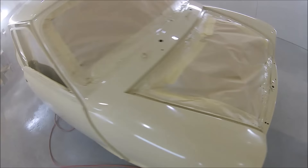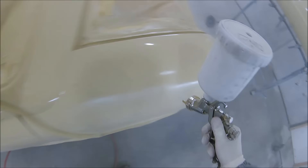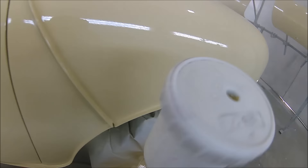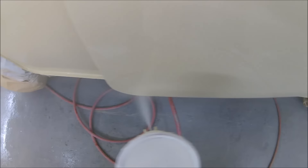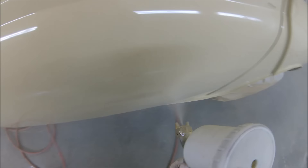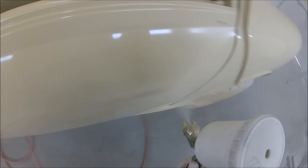Coming in on the last section, I hope this video gives you a good insight into what the standard W400 from Iwata sprays like. To summarise: 1.3 setup with the LV2 air cap, direct gloss at two to one with five percent thinners. I couldn't really fault it - it gave a nice finish and a really clean look to the job. It needed minimal flattening and polishing, mostly just to nib a few tiny bits of dust out. Overall I was more than happy, and if I'd bought this before the Bellaria, I'd have this on my shelf instead.